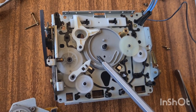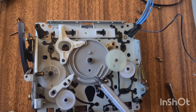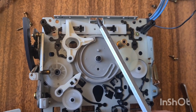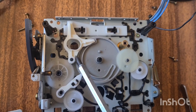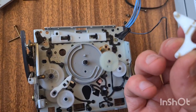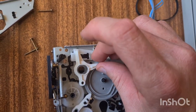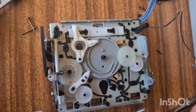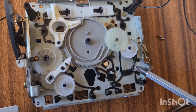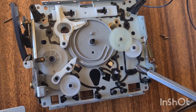It's really pretty straightforward. This has quite got a little bit of wobble on it, which is fine as far as I'm aware. It's important that when you rebuild the transport, the manual says this cam must be facing over here. This arm has a piece that sits in that groove there — it's important that this bit on the bottom sits into that groove, because when you rebuild it, it won't work otherwise. When rebuilding, this goes on first. Then you can put your mode select belt — the smaller belt — over these two pins, and then pop it onto the motor when you've rebuilt it.